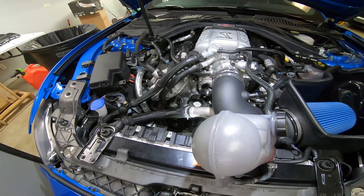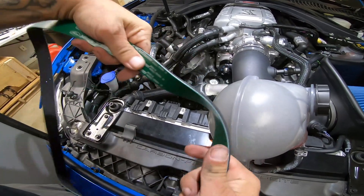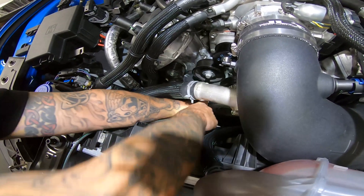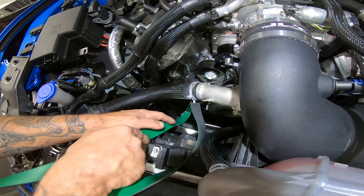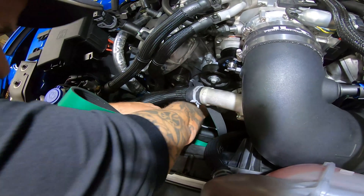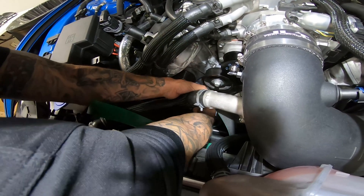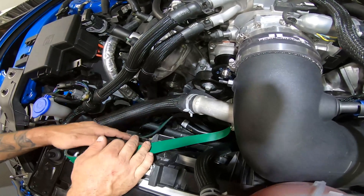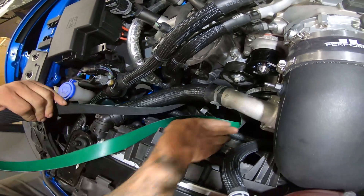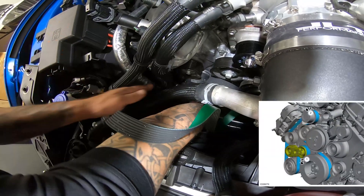Now you've got it off except for right here. You just put the ribs in towards the block and slide that behind the tensioner — there you go, you got it out. To reverse that process, take this belt with the rib towards the block and slide it around the back of the tensioner. Then use the tensioner as your starting point and work the belt around — it gets a little stuck on the tensioner sometimes. I'll put up the belt routing on the screen. The left side is going to go around the air conditioning.